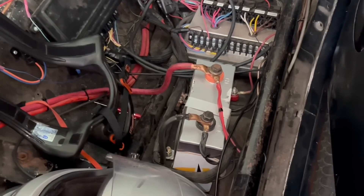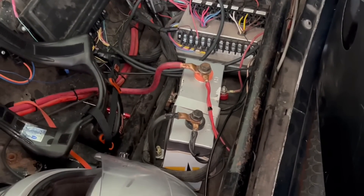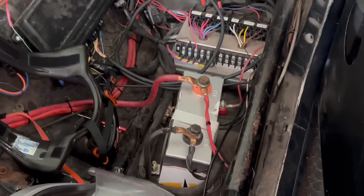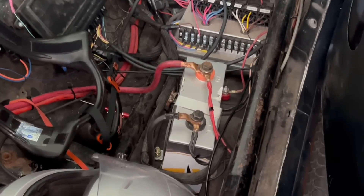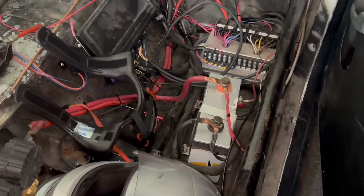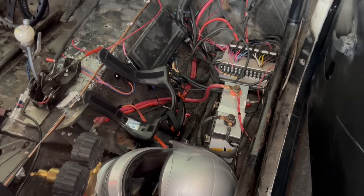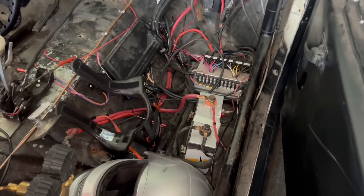But also on this battery, we've got the grounds going to the back of the block, and the auxiliary ones going over to my ground block, and then they're also going over to the Holley. That has to go straight to the battery, and so that's what those cords are — the positive and the negative going straight to the battery. Over here you can see my on/off switch. It goes from there to the on/off switch. Some people will put the Holley connected over there, but Holley does not recommend that at all.